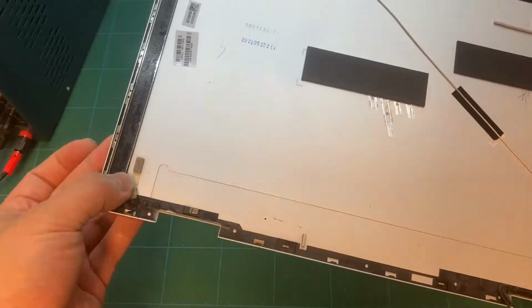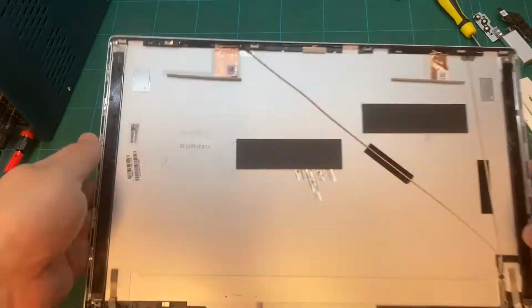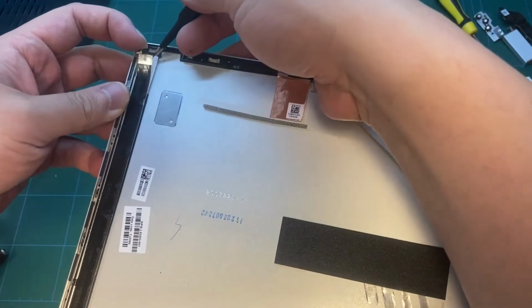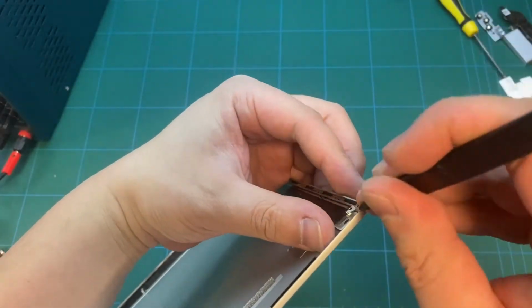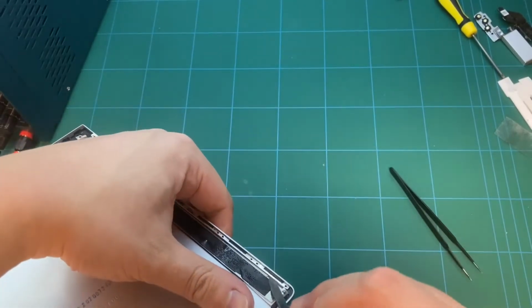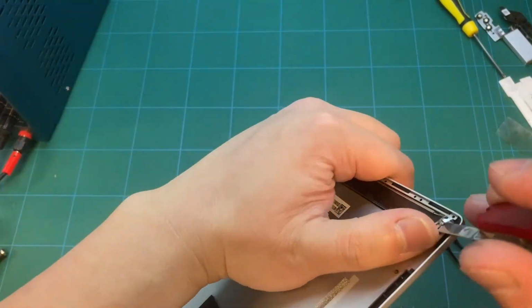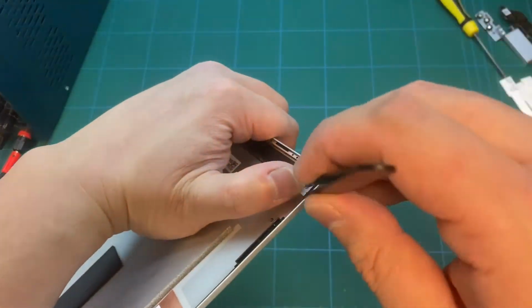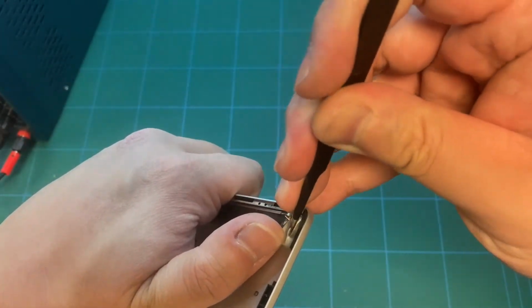After disassembling the screen, we can see the inside structure: they actually put two metal supports behind the screen. And on the corner where I peeled off the support, I saw the paper for taking out the double-sided tape. Then I realized this is the easy way the factory left for people to disassemble the glass. But reaching the double-sided tape remove paper, reaching this area, is quite risky.